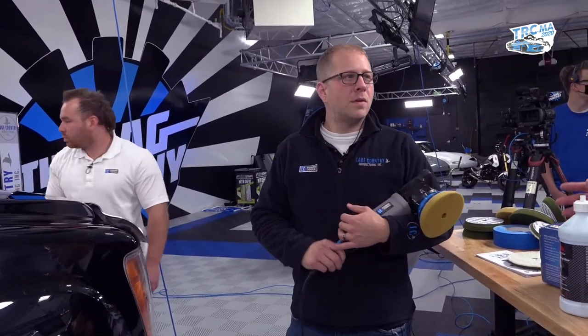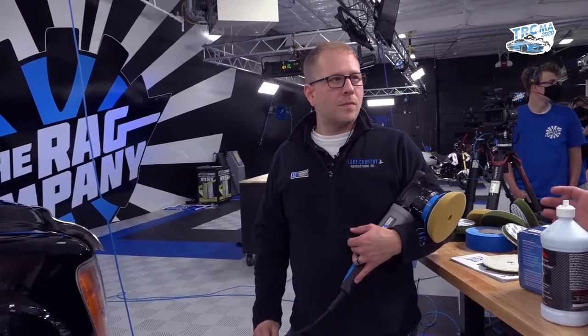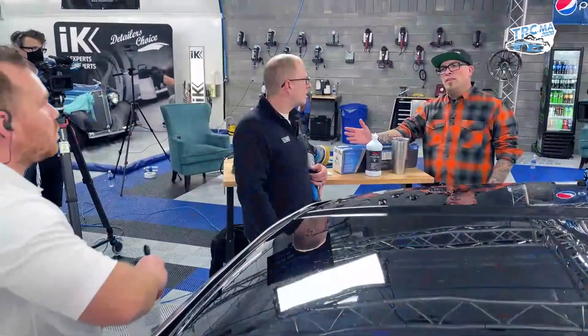Well, and from the amount of training that you and I have done for folks, it's a good rule of thumb. If you're playing with the rotary for the first time, low and slow, like you're smoking meat. You don't want to rush it. It's easy to remember, low and slow, because your arm movements need to be slow. The speed needs to be very low, to at least get comfortable with the tool, especially if it's your first time.